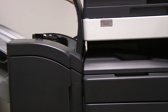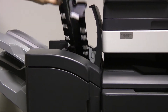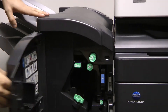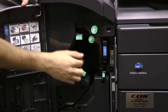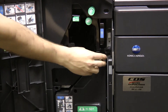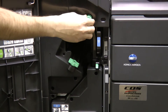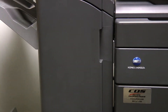To remove a jam from the finishing unit, open the top cover and remove any jams under the compression arm. Next, open the finisher's front door. Notice there are many green tabs that indicate where a jam may occur. Open these tabs and inspect these areas for jammed pages. If your machine notifies you of a jam in the finisher that is not visible, turn the advancement knobs in the labeled directions to push the jammed page into view. You can remove the page from there.